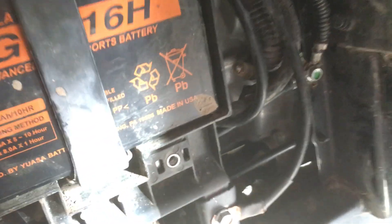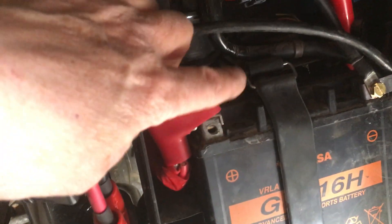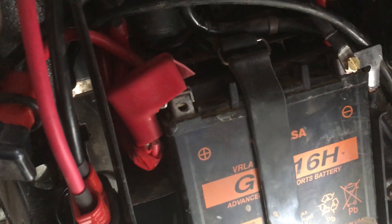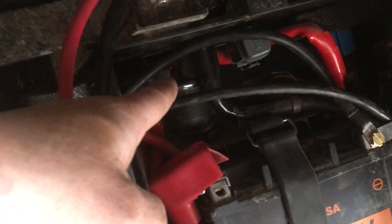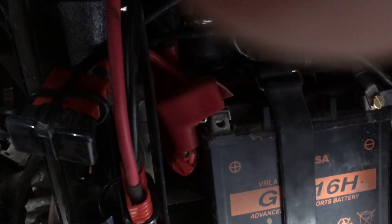The ground for the winch — because there's just a limited amount of room in here — I couldn't put it to the battery, so I put it to the chassis. I scraped away the insulation, polished it, put it there. The positive lead, that is the battery connection, comes down to the battery rather than up to the starter because it doesn't have room. There's no reason to have to put it up there, which is what Honda told its dealers to do. I don't blame the dealer — I blame the technician engineer back at Honda for that kind of a decision.